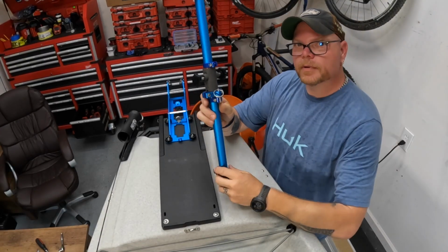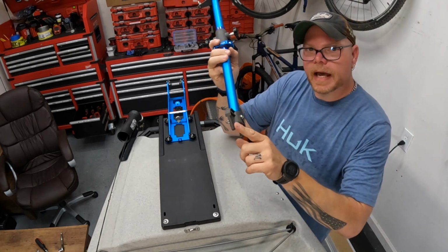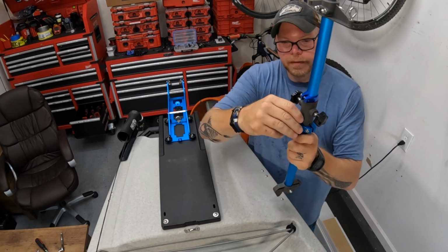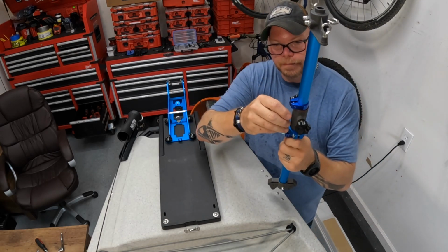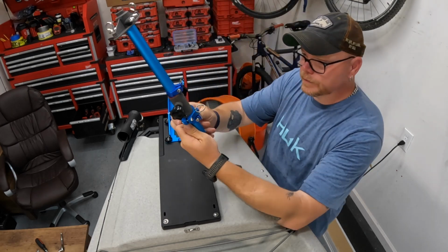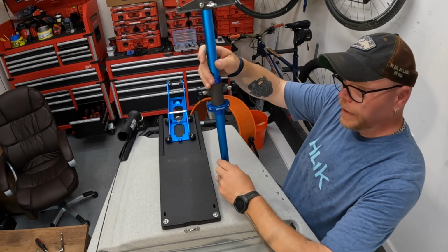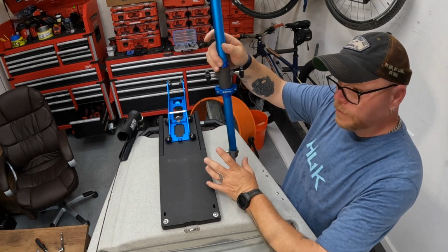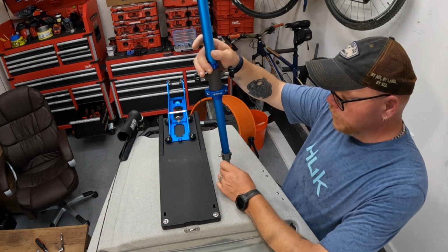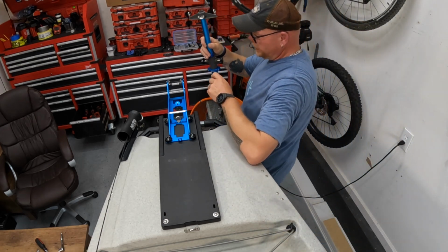So this is the adapter pole from Bixpy. And the motor itself attaches to these holes here on the bottom. You have a pin to lock it in place to keep it straight. And then you have this collar lock, or tensioner. That's what gives you the adjustability to go up and down with the length, so you have this far enough underneath the water. I think they recommend, I'm not sure, it's either 2 or 3 feet below the water line is where you want your motor to sit, so you don't have any pulsating in the back.